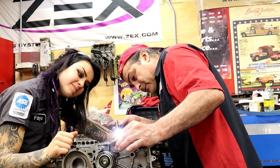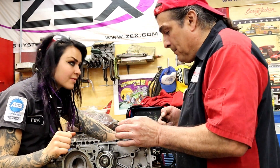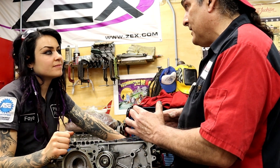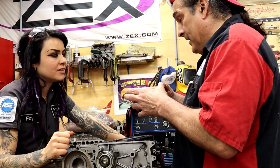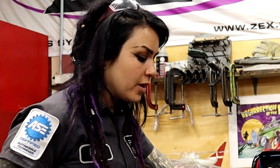I think we're pumping oil because we have too much blowby in the crankcase ventilation. The turbo is not liking that — it has too much buildup of pressure in the crankcase and it's making the turbo push past the seals. Do you think there could have been an engine vacuum or pressure issue due to the timing being off multiple times because of the cam binding?